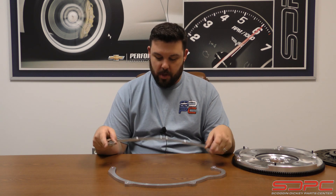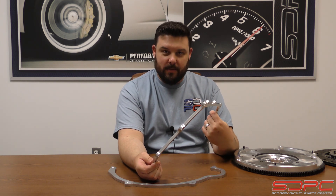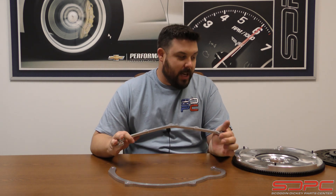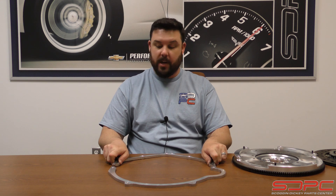We've yet to see a failure that's cheap. Now, one question we've gotten about these that's pretty serious is: won't spacing the bell housing about three-eighths of an inch mess up the stack height on the clutch in total for the throw-out bearing? Actually, it will. The reason ICT Billet does not include any type of spacer for your throw-out bearing — or internal slave cylinder, as some call it — is because every clutch has a different stack height specification, and there are different throw-out bearings for different applications. There's no way they could offer this kit and have it be one-size-fits-all. They offered as much as they could in a single part number; it is up to you to figure out the rest of that stack height.